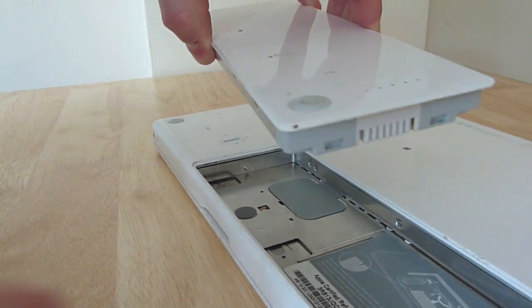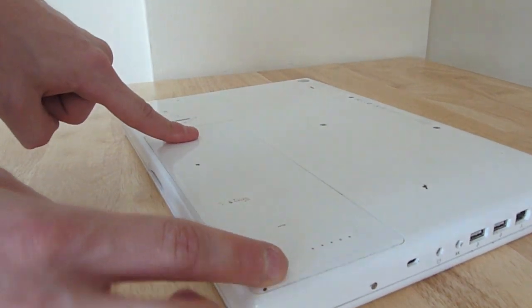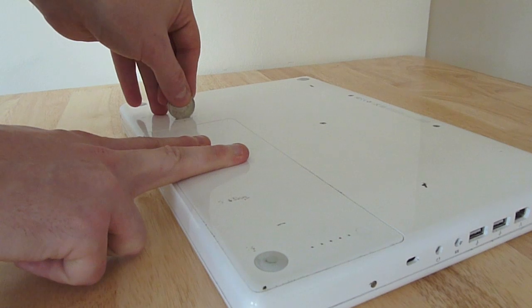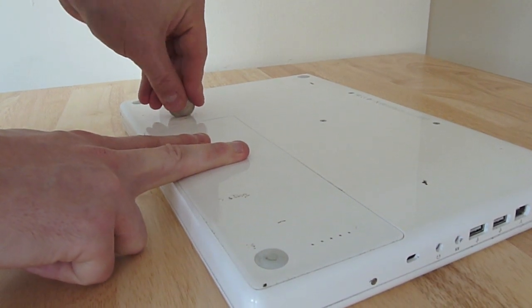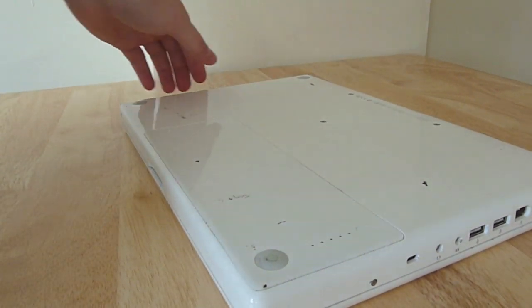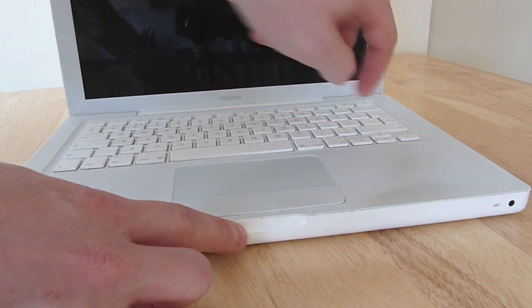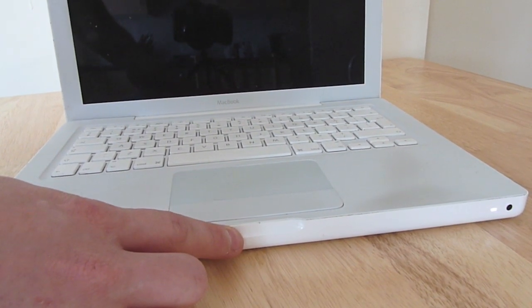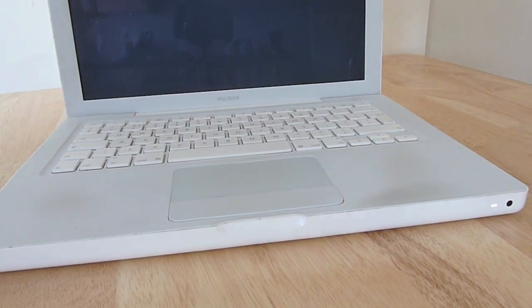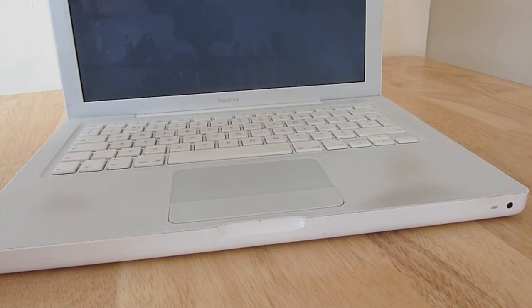All we have to do is reinsert the battery into our laptop. Just push it in this end first, and then with a little bit of pressure on the top, put the coin back in, and then a quarter turn anti-clockwise and the battery's back in. That's all there is to it. If you've done it successfully, you should still be able to power up your laptop. Once you've booted into OSX, Windows, or Linux, just check that you've got all the available memory and hardware space that you should have. Thanks for watching guys.